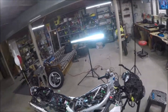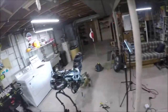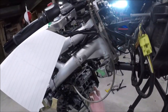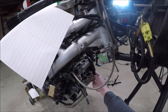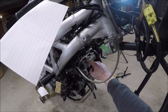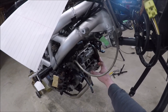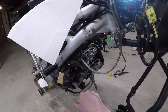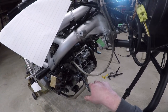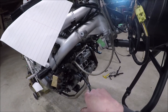So now we've got to get into the actual valve clearance adjustment. We're going from valve clearance check to valve clearance adjustment. This is the part where we need to start taking off the cam chain protector type thingy. We have to take off the six bolts on each of these guides that the cam is riding on the journal here. The guide holds it on there. We're going to do one at a time, not both of them.